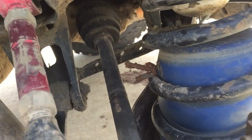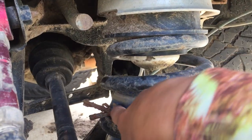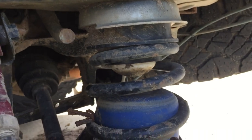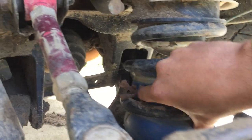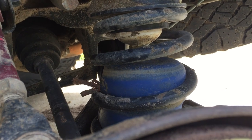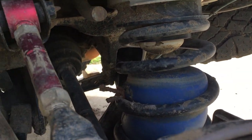Let's show you what we're working with here. This is my tire plug that I've been using. On my trip to Florida it kept getting shot out. It's kind of been a little miracle that I could even plug it this way and have it hold pressure at all, because the hole is not a round puncture — it's a Sawzall blade tip that went in there. That's pretty crazy.